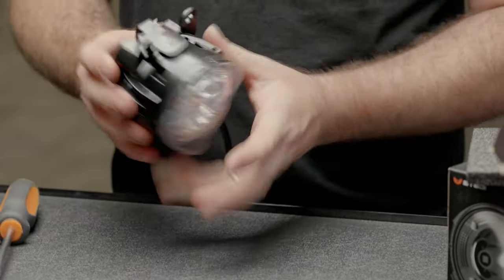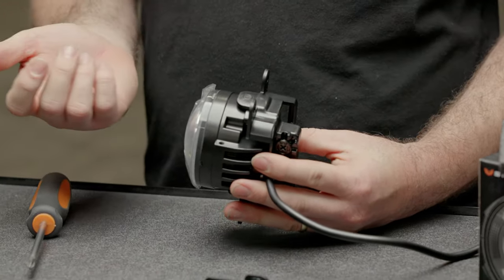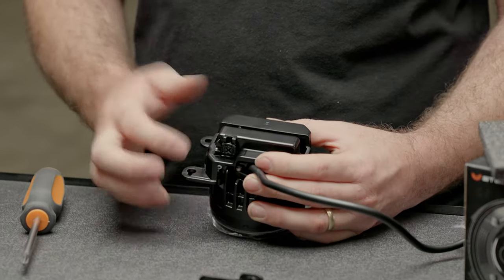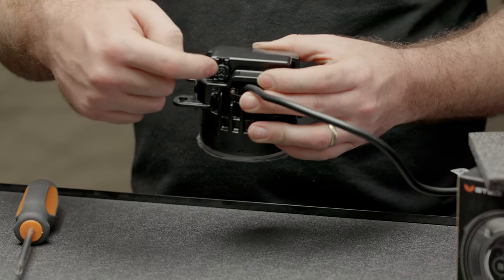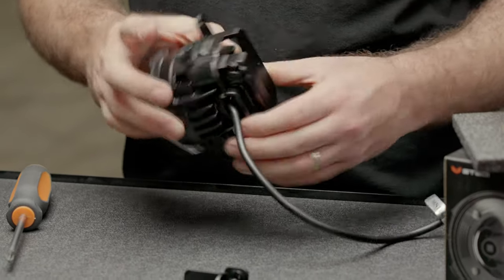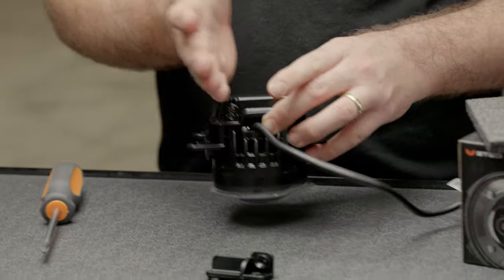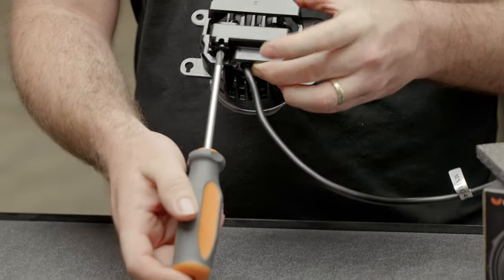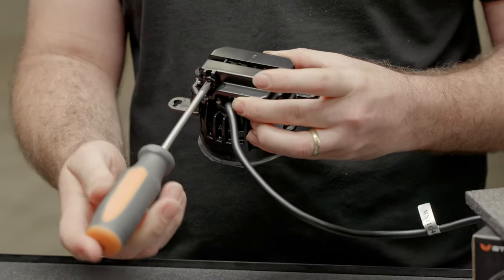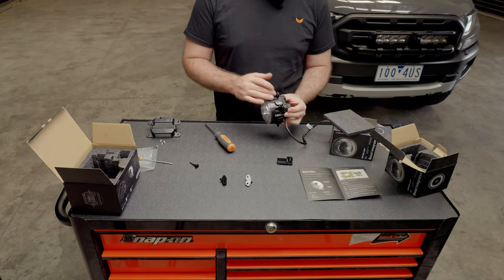Once it's in the vehicle, you want to do your fine adjustment at night time. Repeat that onto the other side — it will be the mirror image of this. When you go to your vehicle, line this up with the adjusting screw on the same side as the original fog lights. If you don't have a fog light in your bumper, just line this screw up where it's going to be easy to adjust — make sure there's plenty of room for your screwdriver to get past any structure behind the bumper. Once it goes in, bolt it into place.